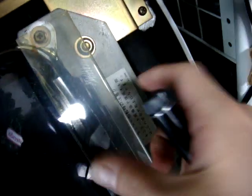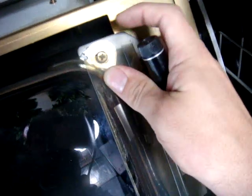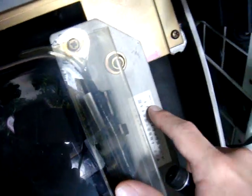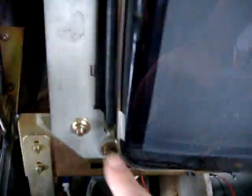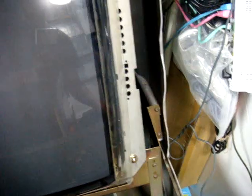With this monitor, you're going to take off these nuts here. There's one here, and it's connected to the bracket. Don't remove the nuts or screws from the monitor holding it to the steel plate — remove the nuts that are holding this steel plate to the brass plate. You've got one here, one here, one here, and one here. This is where your socket wrench will come in handy. Use the 12mm and it'll snap right on there. Don't worry about trying to hold the monitor while you take these off, because they're all on posts.